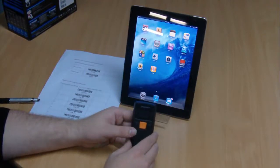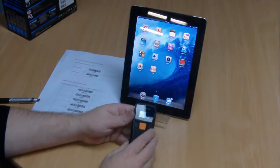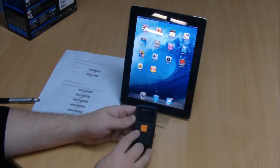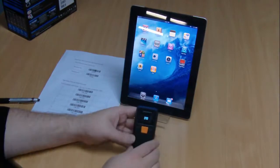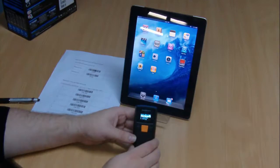The next step is to reboot the device. To turn the device on, all you have to do is hold down the left arrow key for a few moments until you hear a beep. Release when you hear that beep and you'll get the menu back up on your barcode scanner.